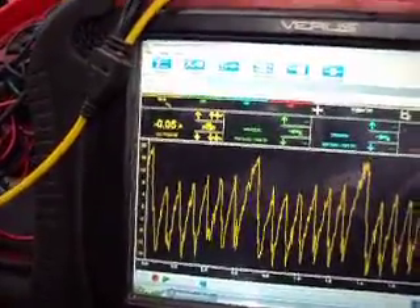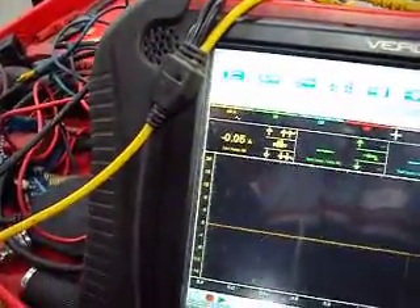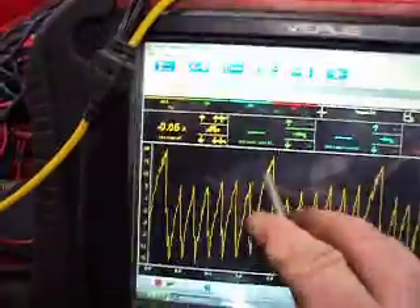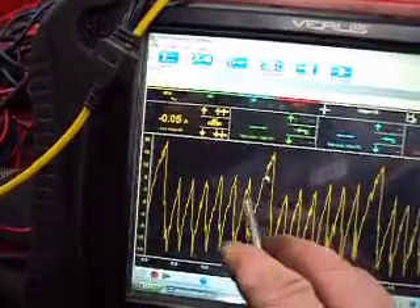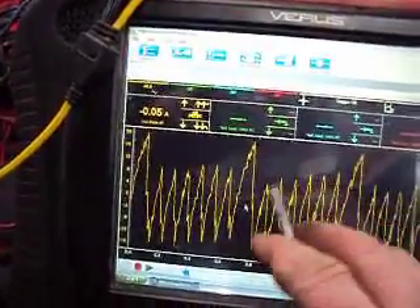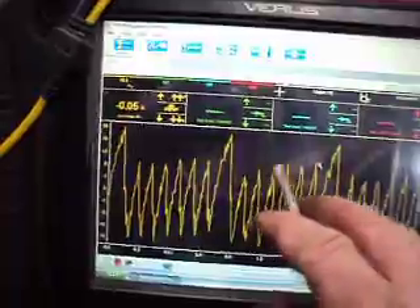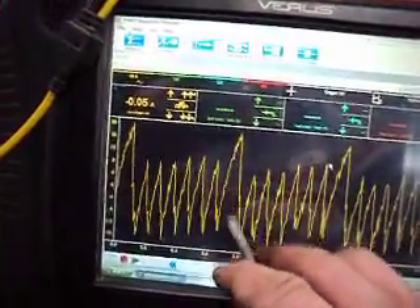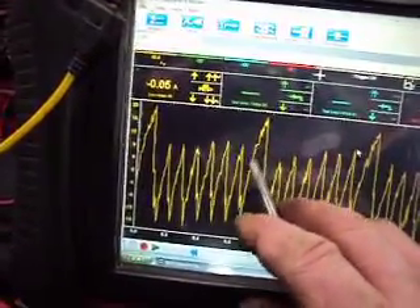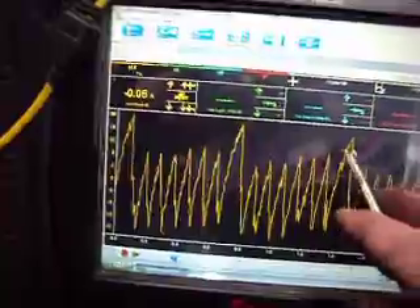Here we see the full amplitude of what you can do with a low amp probe. What you really want to look for here is a repeating pattern. Every time we hit the dead hole — the one with the spark plug out — we see a missing spike here, but then it slowly builds up amperage. Until you fix this problem, you shouldn't pay too much attention to this gradual slope of increasing amperage draw of the starter, because it has to make up for the cylinder that comes right after the missing cylinder that doesn't have any compression. It has to work twice as hard to make up that speed, so you're going to get this kind of rising effect in your amp draw.